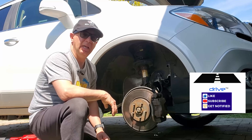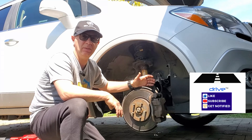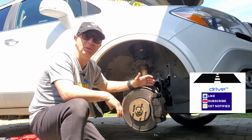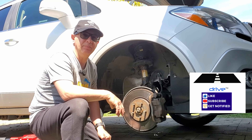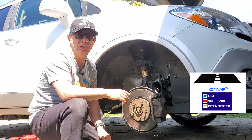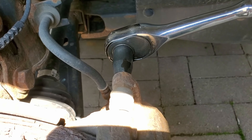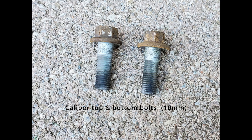I've already measured and there are two bolts back here, which are both 10 millimeter. On your vehicle they may not be 10 millimeter — they could be 8 millimeter or 15 millimeter depending on the size of the vehicle — but there are always two bolts holding the caliper to the caliper bracket. This is the top bolt of the caliper. I've attached the wrench with a 10 millimeter socket ready to loosen it. The one at the bottom is located right there.